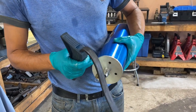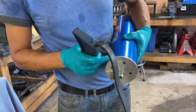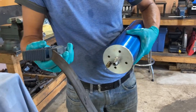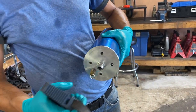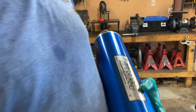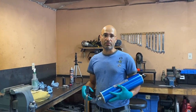After that was done, I wanted to tighten the nipple — I removed it and put some thread locker on it. I moved the rubber gripper right in the middle, straight on the aluminum cap, then tightened the nipple. I filled it to 60 PSI and it seems to be holding pressure now. Really nothing to it — simple 15 to 20 minute job once you have it out.